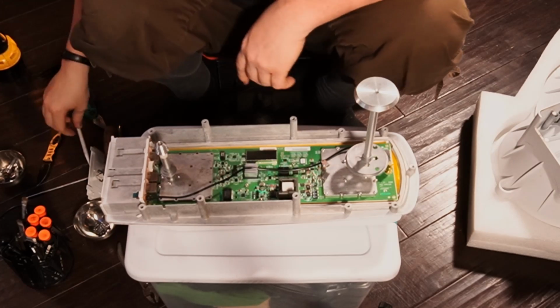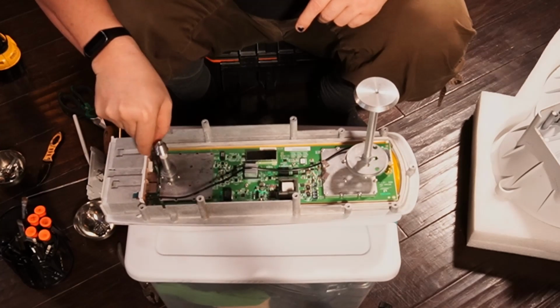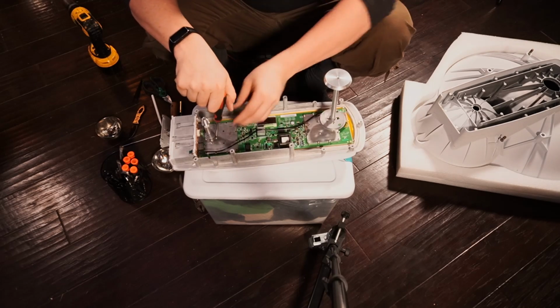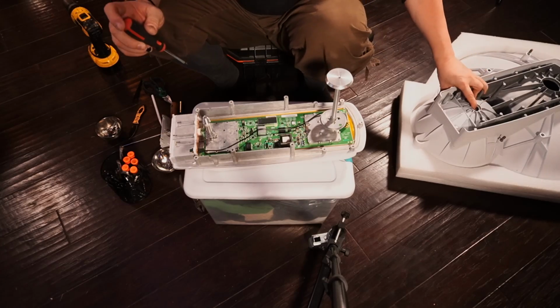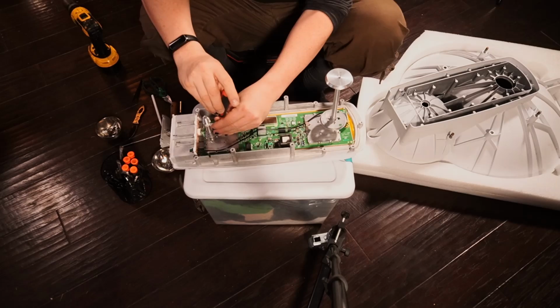And by the way, you're probably noticing now that there's 4 screws that I haven't gotten to, which are right around where the waveguide enters into the chambers here. You're gonna see why in a second. These guys here, it's very difficult to get into them with the actual ground plane here, so you have to be very, very careful with these ones, because you don't want to damage any of these. This actually seals into here. That seals into the socket there to complete the chamber.